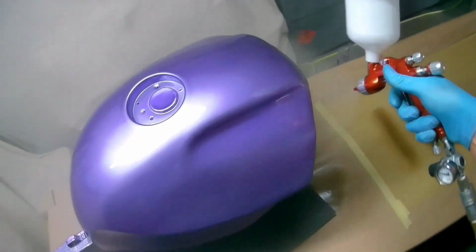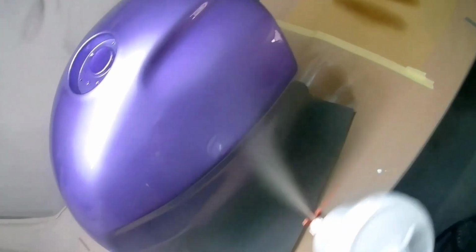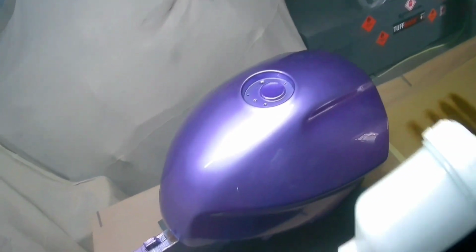And to actually put your clear coat into a container at 8 degrees Celsius and pour it into the Ford cup, I think it made a difference of about 2.5 times the flow rate. So warming your clear coat up will have a really good effect on it. If you have a good quality clear coat that you warm up as well, it amplifies that effect as well. So definitely worth doing.